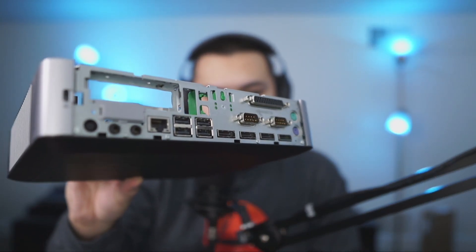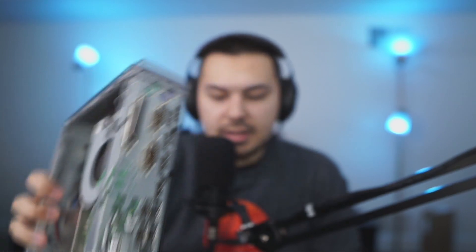A lot of people like to use these for day trading because of those four DisplayPorts. It has some sort of Radeon Vega graphics on board — it's not super powerful, but it can play some basic games and do some emulation. I've seen people use it as a small day trading machine where you can hook up four monitors. Especially with 1080p monitors, or if you need 4K, it can do four 4K monitors at 30 FPS where you're not doing things that are very motion-sensitive. It's probably going to be the cheapest way to hook up multiple monitors in that fashion.